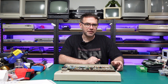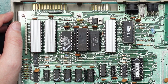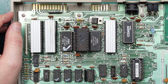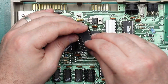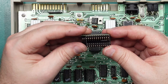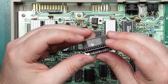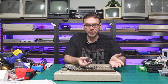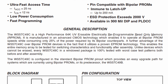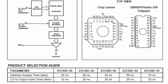So that got me thinking about other things in this machine that fail and need replacing, and one of those is the ROMs. As you can see, in this machine I've had to use a 28-pin EEPROM to replace the 24-pin kernel ROM because it died. Unfortunately, while these things are super handy, they're not the prettiest thing in the world to look at. You need a little interposer board to go from the 24-pin socket to the 28-pin EEPROM. Now while there were 24-pin EEPROMs, they haven't been made in a very long time and they're pretty hard to come by these days, and you also need a specialized programmer to actually program them.